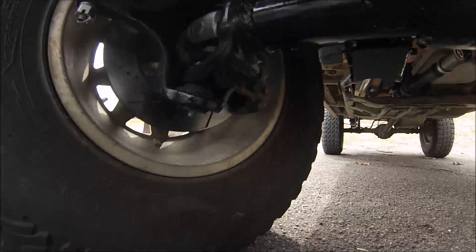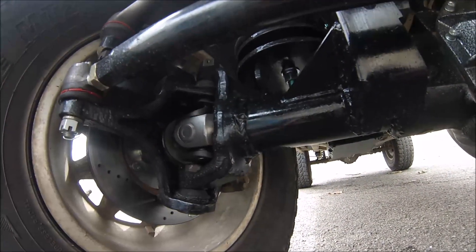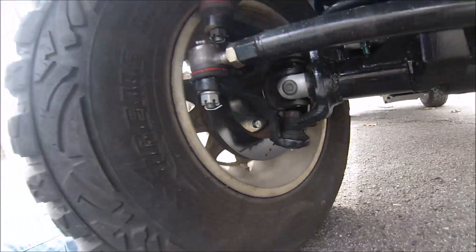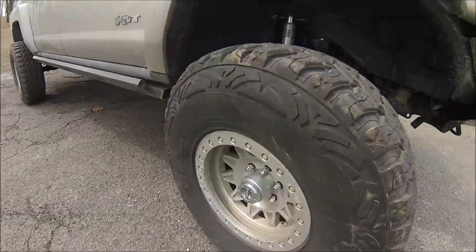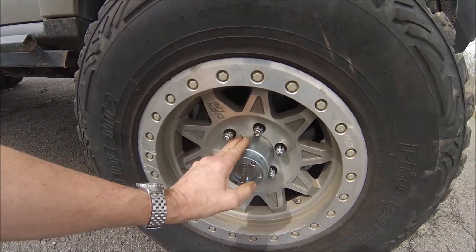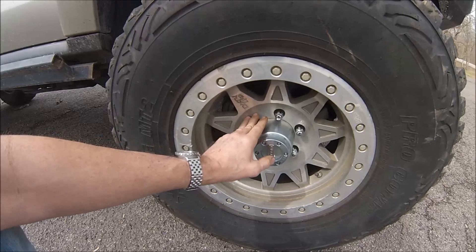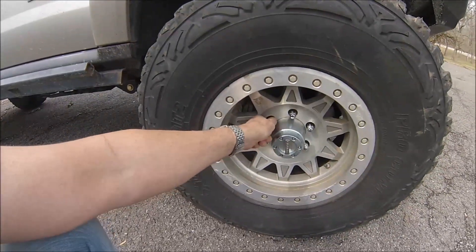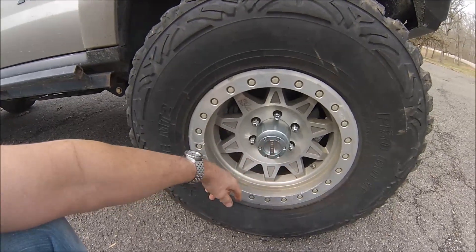Out at the ends of the axle we're using a Thor Parts ABS hub kit. Inside here we have Yukon chromoly axle shafts, Spicer solid joints, one ton tie rod ends and drag link ends. Another Solid Axle Industries piece is these billet hubs, and there are also billet spindles behind here. These hubs had to be turned down to fit these wheels. Additionally, we installed 14mm studs all the way around, because we couldn't find any 12mm studs the right length to fit these hubs. And then Yukon Hardcore lockouts.